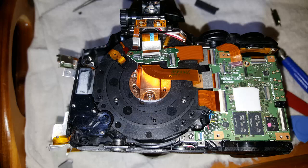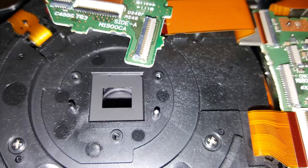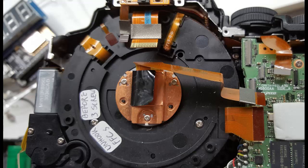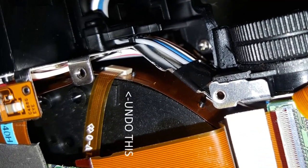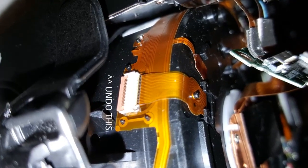I prefer to remove the lens without removing the CCD sensor. Before removing the three screws that hold in the lens, you must remove the two FFCs — one to the focus and one to the shutter assemblies. The focus FFC is about three millimeters wide and goes up and under the viewfinder bits and pieces. It'll push in and out so it's easy enough to get out with a good pair of tweezers. The shutter aperture FFC goes over the left side of the lens at about nine o'clock. It's not exactly the same type of connector as the others, so you lift up the flap on the opposite side of the FFC entry to release it, then free the FFC from the pin in the center so it's free to slide into the lens holder.